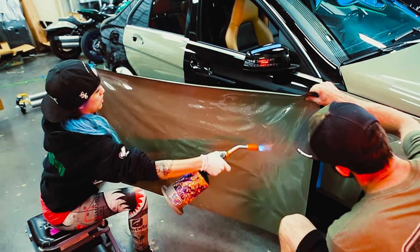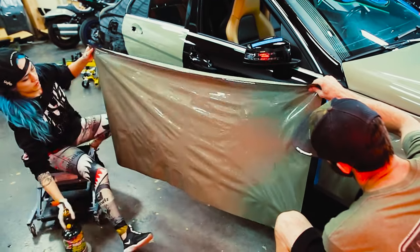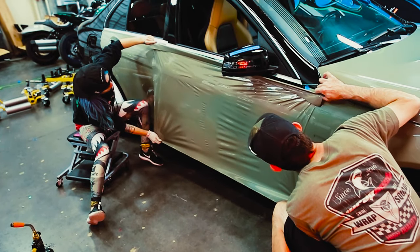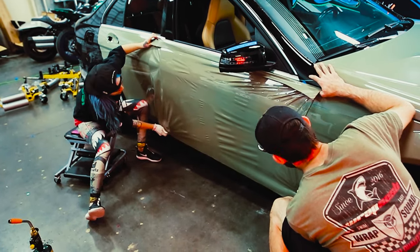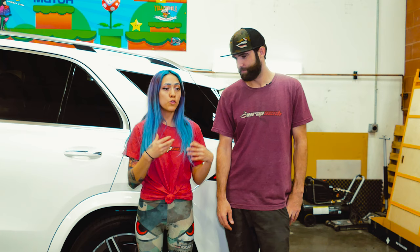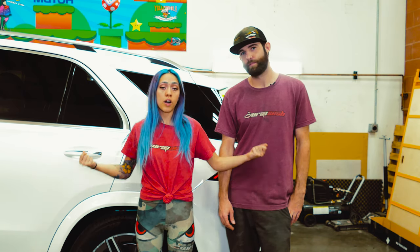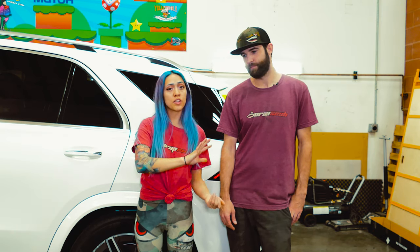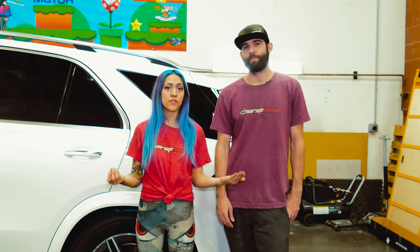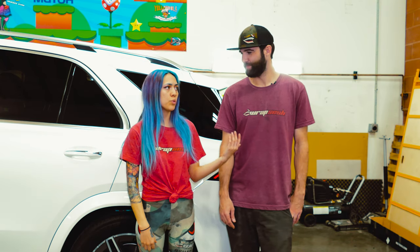When you're going to pull a panel, we still recommend trying to glass out a panel — that's where you're pulling tension on all sides to make the panel flat and smooth already, and then just touching the film down. This one's a little harder to do that with because it tacks so much. It's easiest if you do a full pull, pulling in large sections from body line to body line, with one person keeping tension and keeping the vinyl off the surface, and the other person squeegeeing.